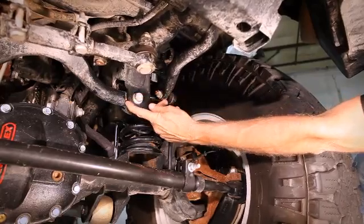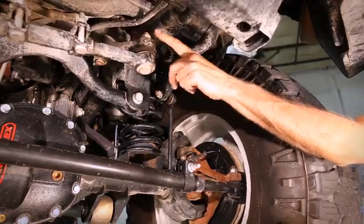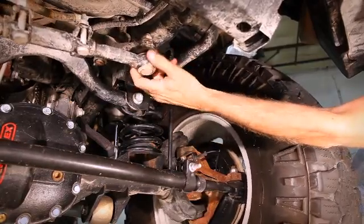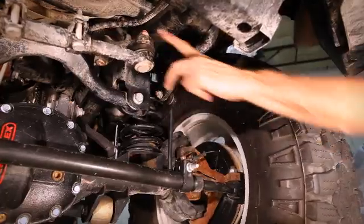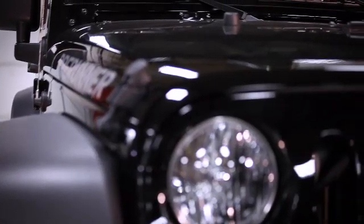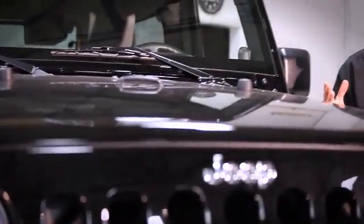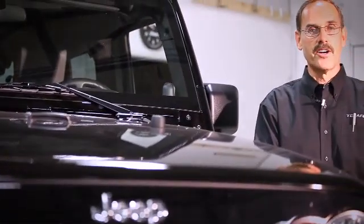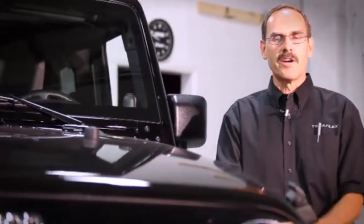There's a little bit of movement in this one, but not much at all — it looks really good. You can also take a look at this pitman arm. The pitman arm and the adjusting sleeve all need to be checked to make sure they're tight. This exercise is one of the quickest, most effective ways we have of checking steering components. This thing is now ready to go. We did a TJ long arm kit last night, and it'll be a great one for us to align.